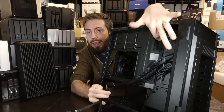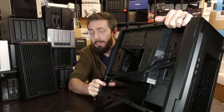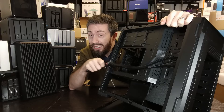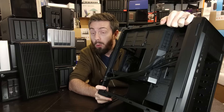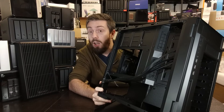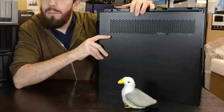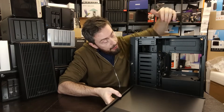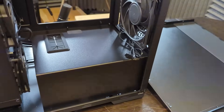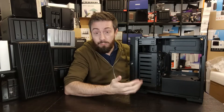These rubber cavities are built in to allow cables to be funneled through. You might think it's just a hole for cables, but loose cables in a vibrating case make noise — not a lot, but once the whole system is vibrating it all adds up. Having cables filtering through these rubber-paneled areas minimizes vibration. And it isn't just there — turning the case around and removing the other side panel reveals further rubber cable captures: one just above the PSU and dual panels on the side for the front panel cables and any other cables.